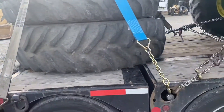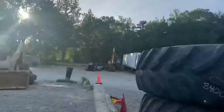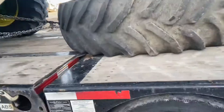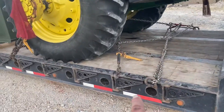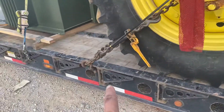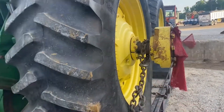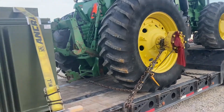Then I have the tires here. You can see — straight from here and from there, going crossing. I'll show you up here — just crossing, then come back here and put it right here. One goes to this ring, this one to this ring. Obviously you put the flags. On the trailer right there, so it's not going to slip forward, and you have one more to the axle. The flag is here because this is the widest point — so I'm 10 feet wide. It's about 10 inches one side and 8 inches the other, not exactly perfect, but the point is you're 10 feet wide.